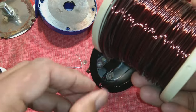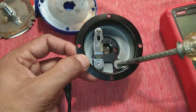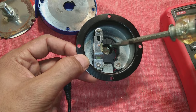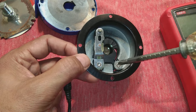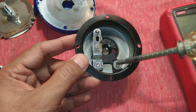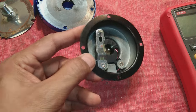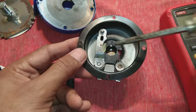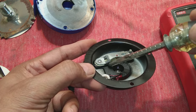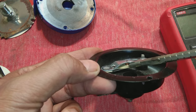In some horns, screws or nut bolts are provided so you can open the contacts and remove all parts to access and rewind the coil. In this case, rivets are used — you can open the rivets and replace them with small screws or nut bolts. But first, we will check the coil since the coil seems good. The armature has a fiber part on top and metal underneath, and there are two contacts — the CB contact set — which are opening and closing contacts.